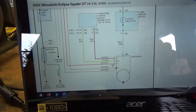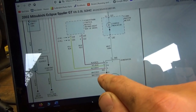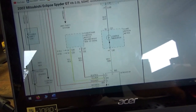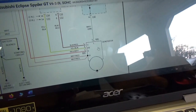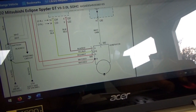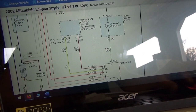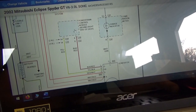Alright, wiring diagram — so this is the redrawn generator. The big battery positive post — those wires go through a big fusible link, 120 amp, right to the battery. Now the four control wires: first one and fourth one — black and red, yellow and black — go to our powertrain control module. So this alternator is controlled by the PCM, it looks like.